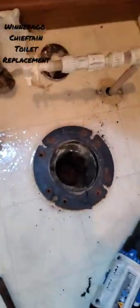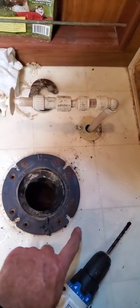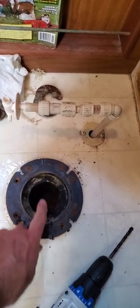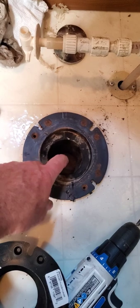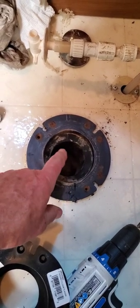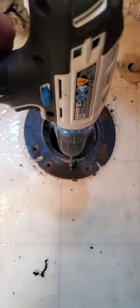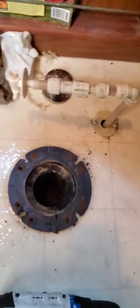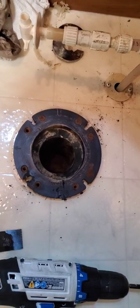I am replacing the toilet in our RV bathroom. The old toilet has flange bolts here, here, here, and here, but they need to be directly across from each other. I've got another flange I could reorient, but that means trying to get this one off — it's glued on to the pipe that goes into the blackwater tank. So instead, I'm going to try to drill a hole on each side where the bolts will need to be and cut some little grooves to give me a slot underneath.